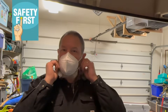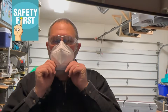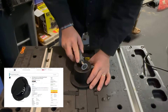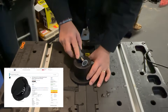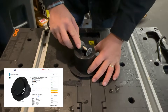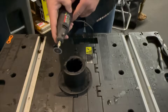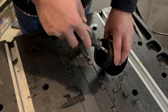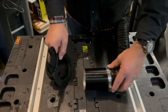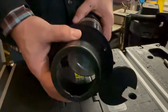This next section involves cutting into plastic with a small power tool, so think about safety and open up that garage door. What I'm cutting into is the RV electrical port - this is where RVs keep their 30-amp or 50-amp cord. I'm cutting off the little fingers that keep it centered in the hole, then I switch over to my sanding bit and make that cut nice and smooth. Now you'll see that the rigid three-inch ducting fits really nicely into that port - that is how I'm going to get the diesel heat into the RV.